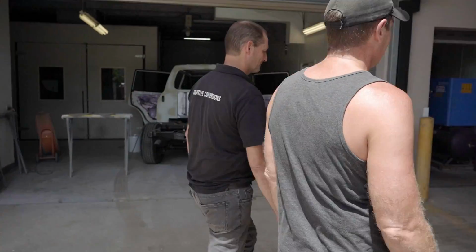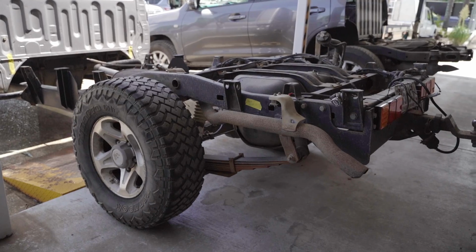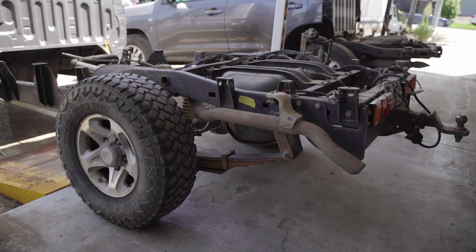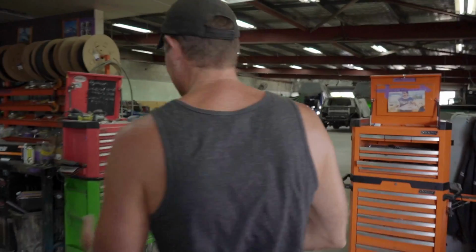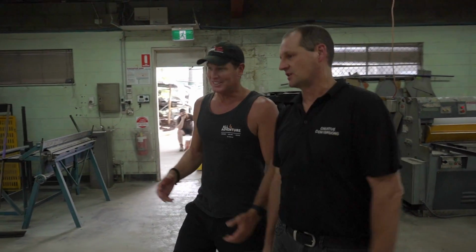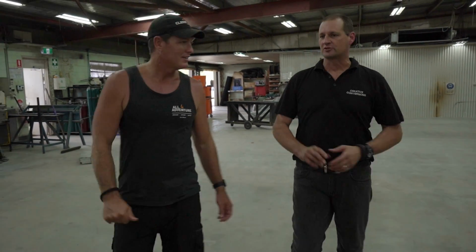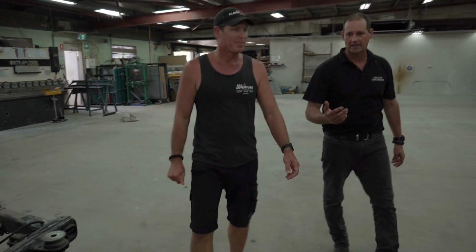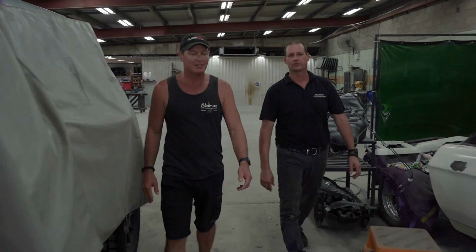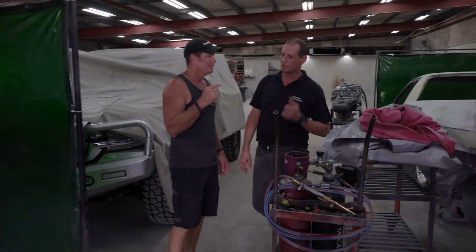All right, chassis. When you're doing a chassis, my truck has a 650 extension, which I've found over the years building trucks is the optimum length. But you've done up to like 950. That's correct, yes. That's a huge extension. Do you have any 950s? Not here at the moment. We've got a couple of 850s. Anything bigger than 750 is built for a specific build. Someone wants to put a slide-on camper on the back, or they want a big tray for a builder. They're not worried too much about turning circle, but they want that carrying capacity and the comfort of that 200 series.